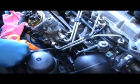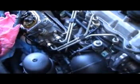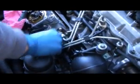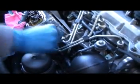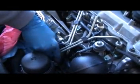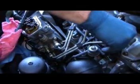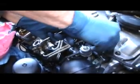You have to kind of be careful not to break the orange plastic dipstick collar when you do this. In fact, you can just reach down and pull it straight out, get it out of the way. And that'll keep you from breaking and having to replace it. Set those up there in a clean spot.